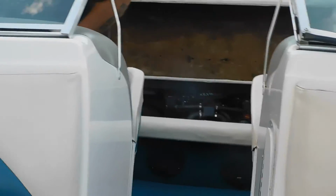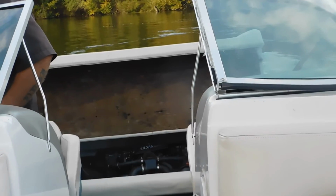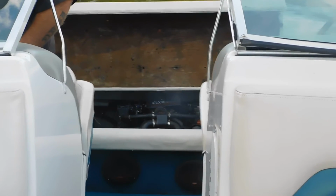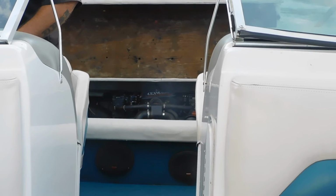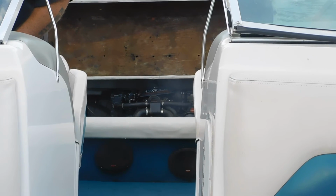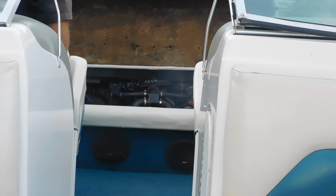You have to see, you feather it. So it's going to have a carburetor issue. Go ahead and back her back down. And without feathering it, go ahead and just give it a 3/4 throttle. So that's the accelerator pump not squirting extra gas. For it to come up on RPMs, you have to sit there and feather it, squirt some gas in there.